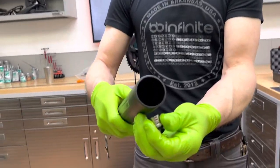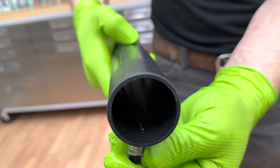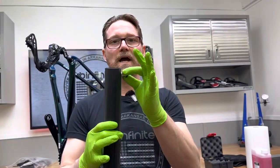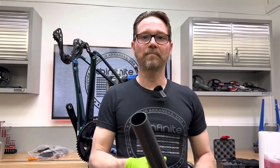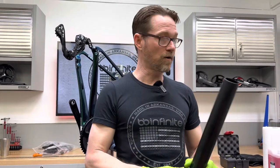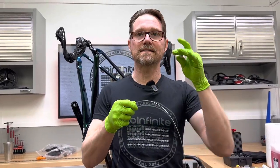Imagine this is the frame. Here's a magnet — it's pretty simple. See the wire in there? See what I can do? See how I'm steering it? A lot of you people have seen this trick before. Some people like to use the magnet to drag it. If you're lucky, that'll work, but not all these bikes are smooth inside. Some of them have a seam and they've got some stalagmites and stalactites in there — you're not going to be able to get past it quite like that. You need to have the ability to just steer it, and this is why we need to use the inner wire for a brake system — we need it to be stiff enough that I can push it, because what I'm doing is pushing it from one end and steering it with the magnet.